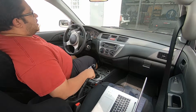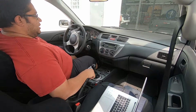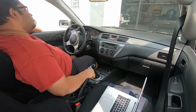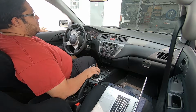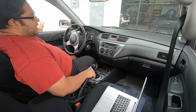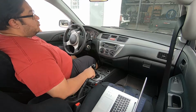The customer still wanted the intake to look normal, so the MAF is still there, but we're not using the MAF. It is a little restrictive, especially for aftermarket turbos that are larger, but we're gonna see. My goal for this car is to make the power, yes, but more to keep a really nice feeling, and you know, everything feels natural. It has a manual boost control.